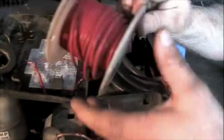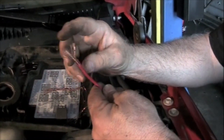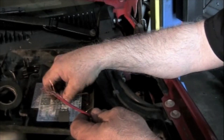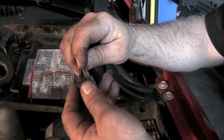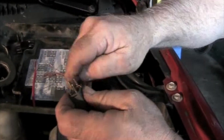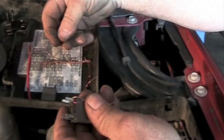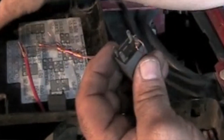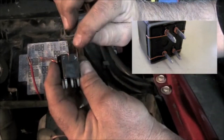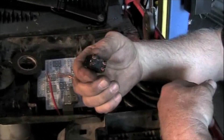Here's how you do it. Just take some regular old stranded wire that you have around the shop. Cut it open to where you can get the strands out — I've already got some of the strands open here. You take the relay that you want to make a test unit, hook a strand on here, and wrap the wire around it. Pull it tight. Bring it up to the top, then take another strand and do it on the second one. I've already got one made up to save a little time and it looks like this. Wrap the strand around it, bring the wire up to the top. Do it on all four. Take regular old black tape and wrap it around there. Now you've got yourself a test relay.